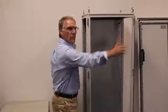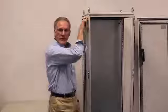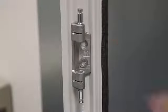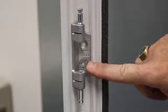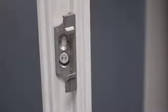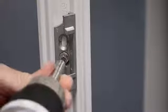So now we've got four hinges on this side and four catches on this side. The next thing I'm going to do is show you how to reverse those. For each of the four hinge bodies on my right-hand side currently, you'll notice there's a T30 screw. All I need to do is take that out — do that for each hinge body. Now do the same thing for the catches on the left side, and do all four.